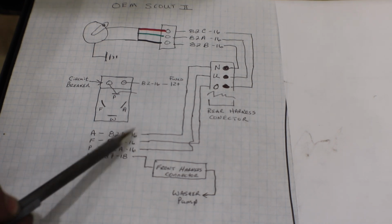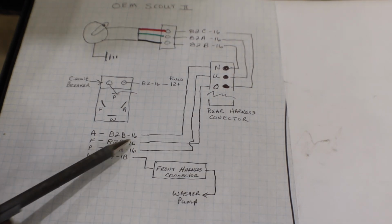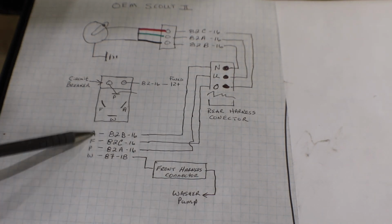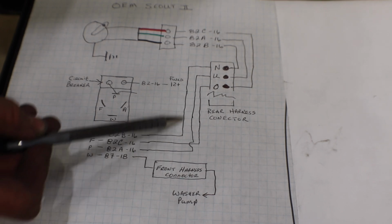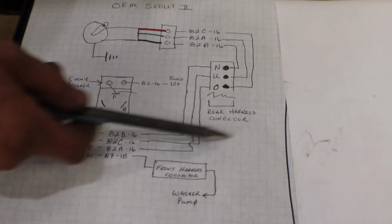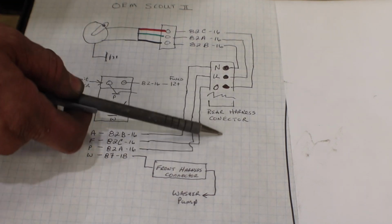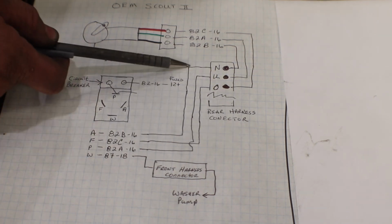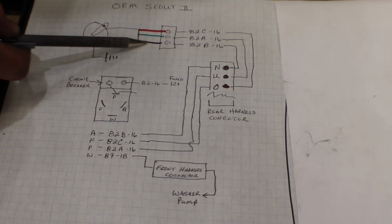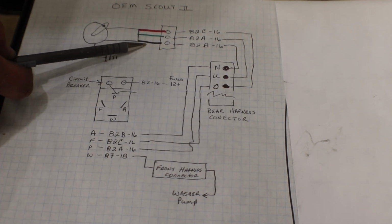But they have printed on them the circuit number and then the gauge of the wire, which is kind of helpful. So A here is 82B, goes up, goes through the connector on the firewall that goes to the rear of the truck. The rest of these pins would have stuff like brake lights and turn signals and stuff like that. But it goes into pin N, as in November, and up.